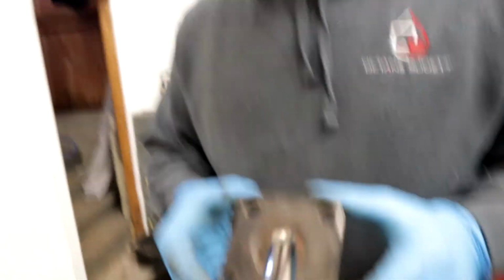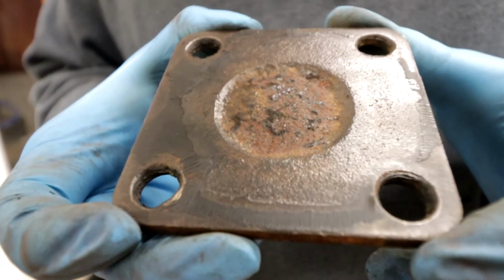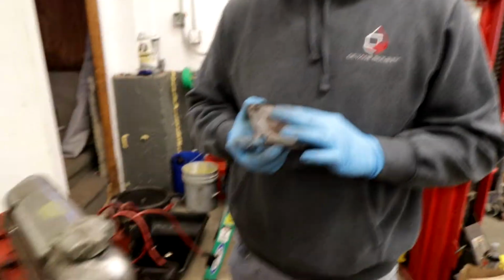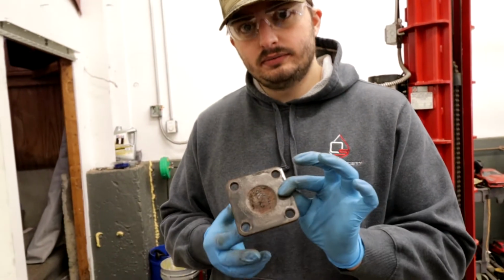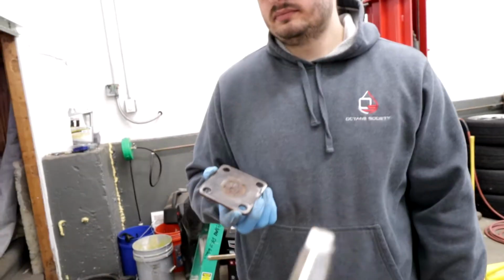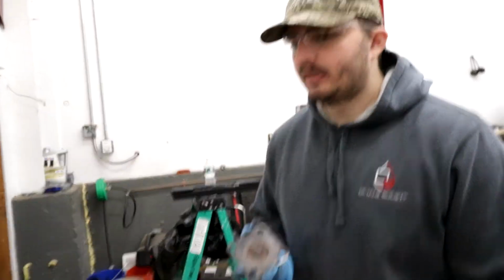All right, so we are having a bit of a moral quarrel here with this. It's obviously very corroded. Ideally, you would replace that or machine it, maybe machine a mil or two off, I don't know, a couple thousandths of an inch. Or make a whole new part. Right. And then we could clean that all up. But because this is the exhaust manifold and we're going to have this thing running with water before we even get it on the boat, I think we're going to test it and see if it fails. Right. Because that gasket's pretty thick. Yeah, it's a thick boy.